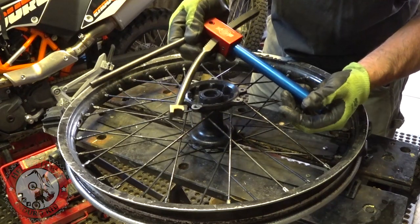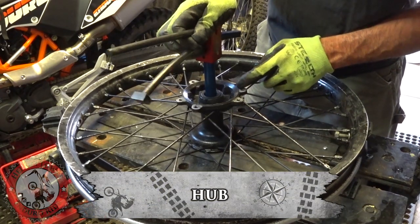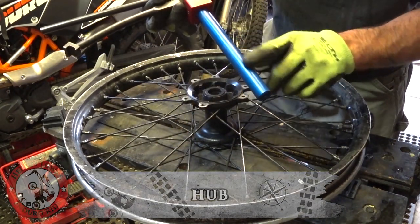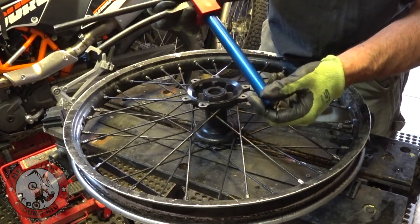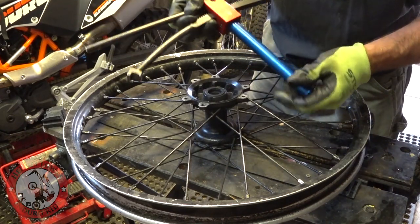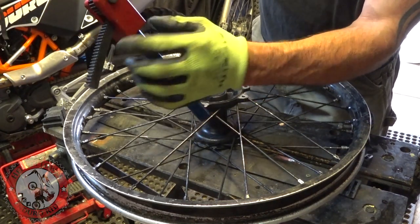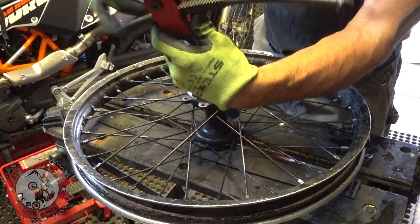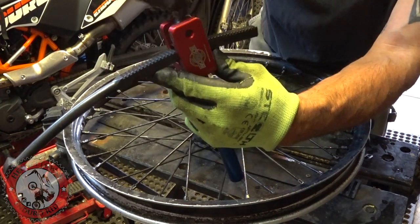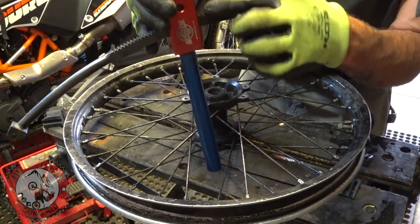When you get the tool — if you get the ultimate kit — it comes with different pieces. This goes through your axle like that, and you can order different axle sizes for different bikes. There's a little set screw in the bottom and this handle screws in. There's a little gear right here — you can see it moves like that — and that's how you adjust the gear lash for the little gear.